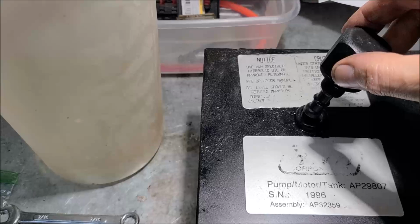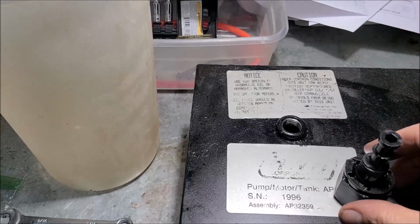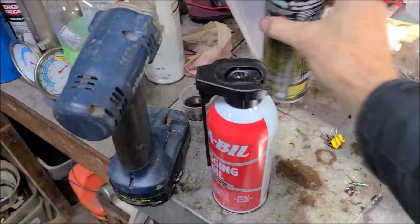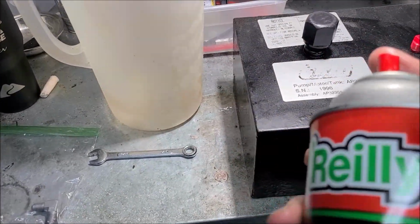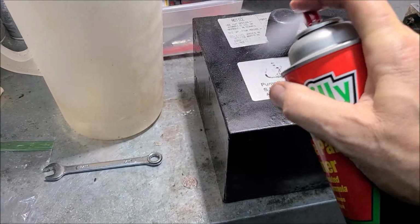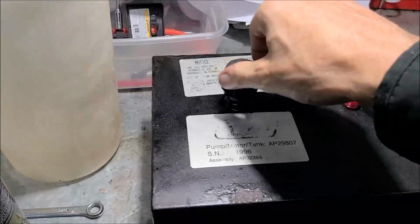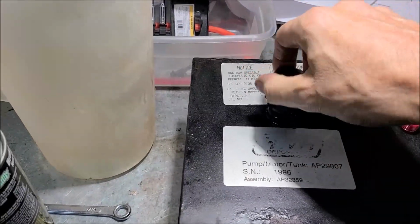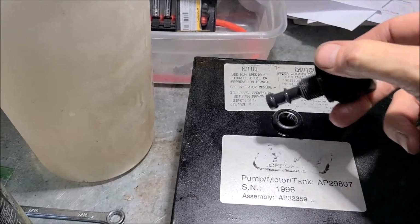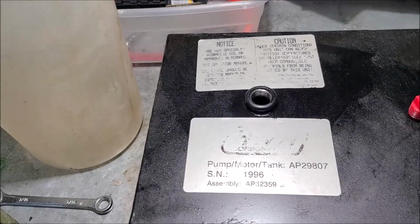And be very careful when you go to take these off, because usually you've got all these hoses and wires in your way, and there's all kinds of dirt and grit. Well, let me show you what I like to do. I like to get me some, where's it at? Yeah, okay, this brake cleaner or mass airflow cleaner, something like that. Mass airflow cleaner might be safer because it's safe for plastics, but just take it and give a good blast all around that area. That way when you take this off, you know you're not dropping any dirt or grit down in that hole. You want this perfectly clean, because all kinds of road grime can build up around that. You want to keep hydraulics as clean as possible. All right, so got that ready.